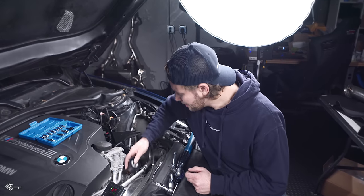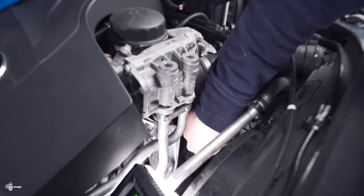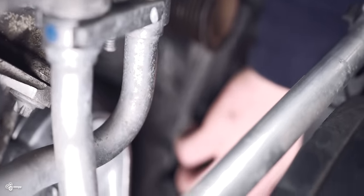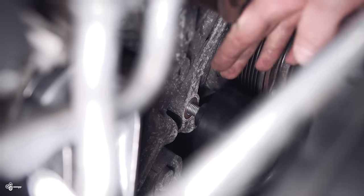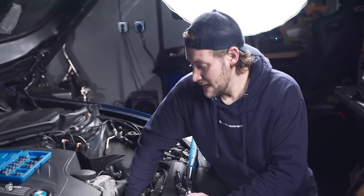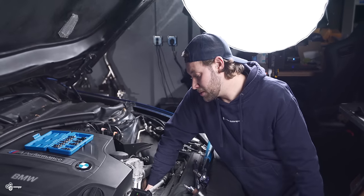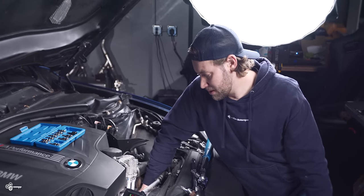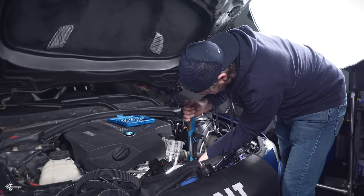Now you can take your idler pulley. Now if you're looking up torque specs in a test document, you'll see it called deflection pulley. So I'm just gonna thread this in like that. It's kind of awkward because you have to spin to tighten the bolt. If you're gonna do it by hand, you have to spin this part. If you just spin this, it doesn't really do anything, so. A little awkward. And then what we're gonna do, we're going to tighten this down to 60 Newton meters. The other one was less, but this one, for whatever reason, is more.